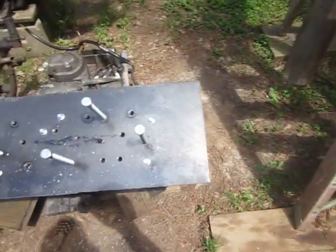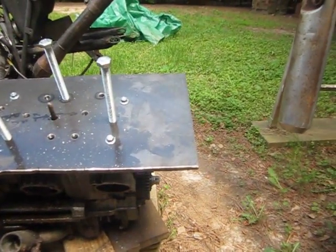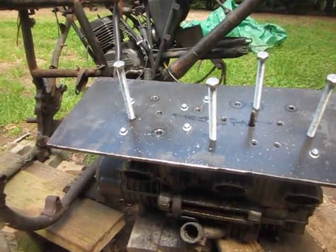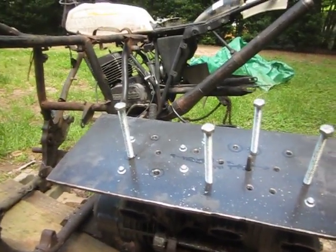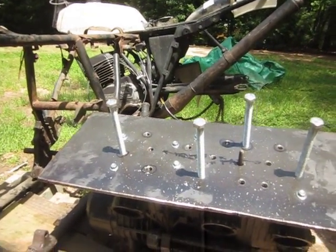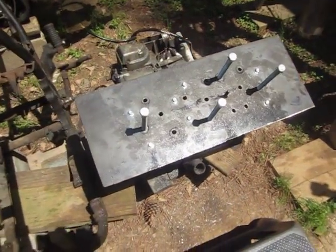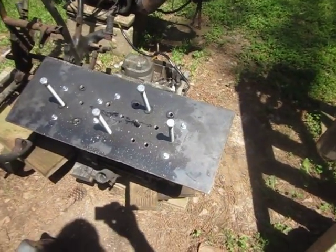The cylinders are stuck as well. So what I've done is fabricate a plate out of about quarter-inch steel, drilled appropriately so that it bolts to the cylinders. These long threaded bolts you can see sticking out push through the fabricated plate, and as I tighten them down they press on the cylinder studs themselves, which go into the case. So basically you have a puller.